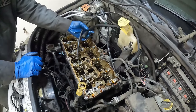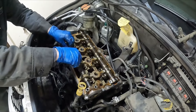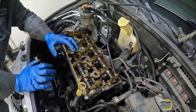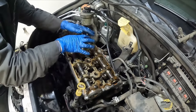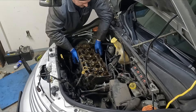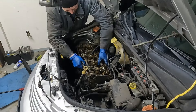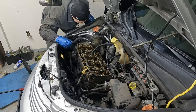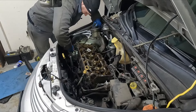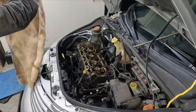Make sure our rockers are in the right spot. I'm going to put the cams back on so we're ready to lift the head — our holes face straight up — just to hold the rockers in place so you don't get a big rocker mess. I'll snug down the two middle caps. I'm going to lower the vehicle some to see what we can do about lifting the head out. The head is still stuck to the block — see if there's a spot to pry, might just be the dowels. Still hung up in the front, maybe on the exhaust.